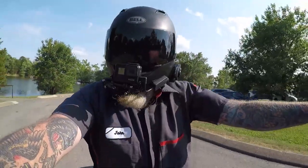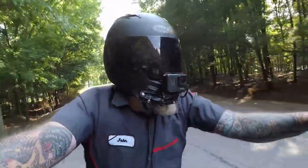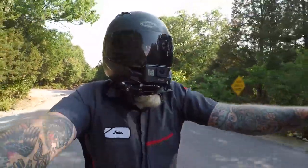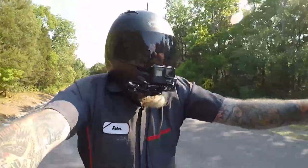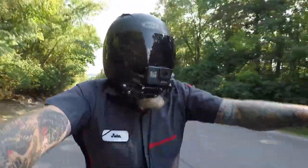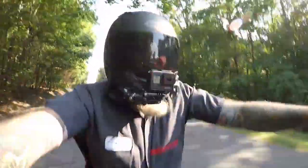If I had to do it again, I would have definitely upgraded the rear sprocket to a better quality, true 530 — because most of these kits run 530 chains. That was a big learning curve and hopefully it'll help somebody out. In the future, if somebody sees this video: stay away from those bunking rear sprockets. They look good because they're cheap, but there are other companies out there that offer the true 530 sprocket for these bikes and they'll last longer. That's the only negative thing I've personally seen from these chain kits — the rear sprockets are garbage. Get a good one and everything else seems to be great, long distance and all.